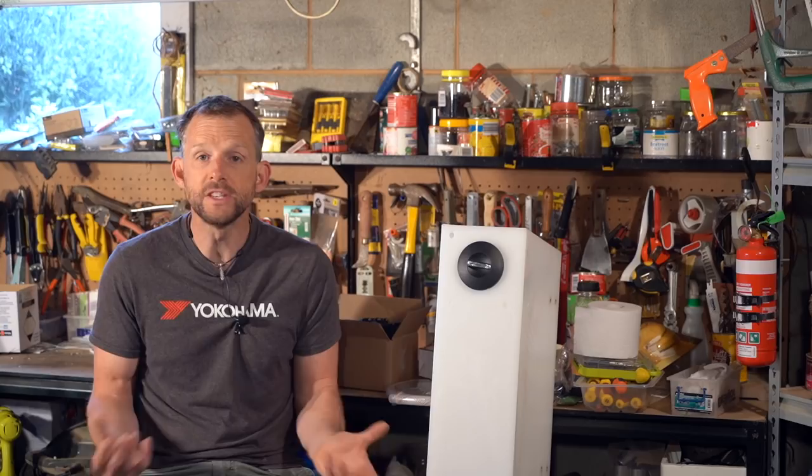When it comes to designing your own setup, the first thing, really ground zero, is you have to think about where are you going to mount a water tank. And this will obviously vary greatly based on what vehicle you have and how you're designing it. Whether you've got interior living space or whether you're living outside under an awning or something. So the placement of the water tank will determine, is it in the way if you want to be sitting inside or whatever. Also remember, if you're going to cold places, think about if the tank will freeze.